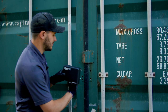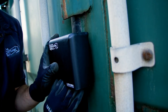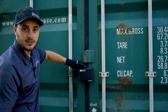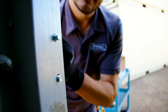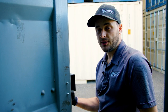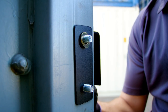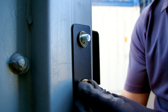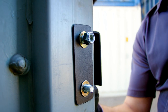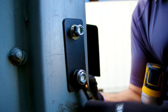Now if you hold these two and hold it up to the door, get them to slide in. Then same thing on the receiver side, make sure the carriage bolts go right through the can and we'll jump on the inside and tighten them up. The proper order here is the back washer plate, then your two grade 8 washers, and then the 7/16 nylock nuts. You'll tighten these up with a 5/8 flat wrench or socket.